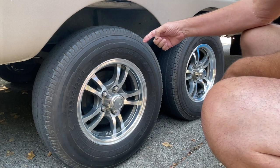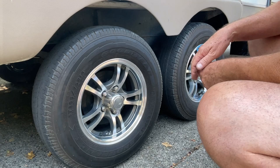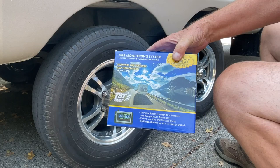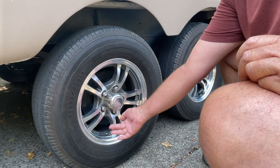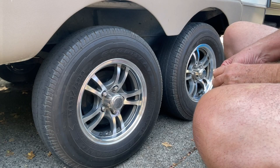What I'm going to do is take my best tire and put it on as a spare, get rid of the Castle Rock tire, and when I go to the shop I'll put the Castle Rock tire side by side with the Goodyear to flex and compare them. Also, I have a TST tire pressure monitoring system installed — I noticed the rubber valve stem caps are showing wear from movement, so I'm going to have metal valve stems put on.